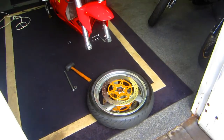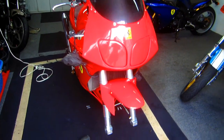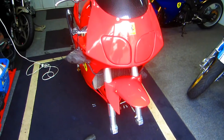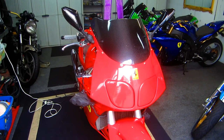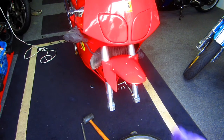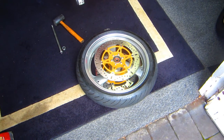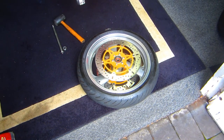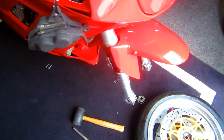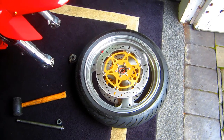I just had a nice coffee break. Ready to put this back together. Just a complete reverse of what we did. Loctite the bolts, and then we have that little thing we did many times on a video, of bouncing the front end with the calipers locked and then tightening all the axle bolts. And that's almost too easy to do. This gave us plenty of time to do it right. I never like to do a job like this if I'm under some time constraint.